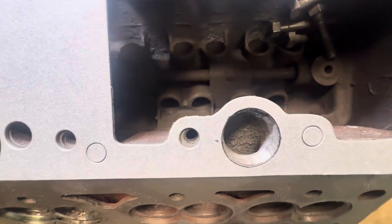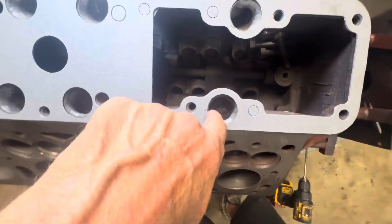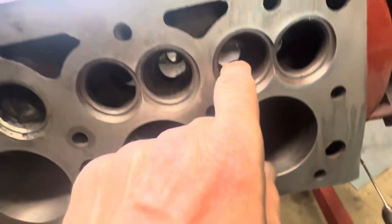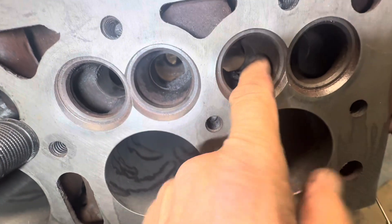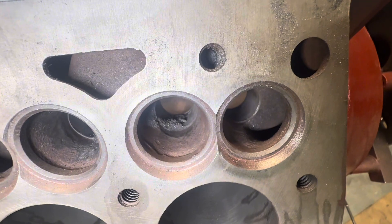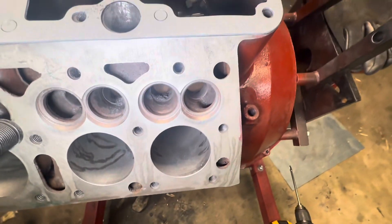Starting to look pretty good. Not going for gold - since there's no flow meter or anything here, I just want to open this up and make sure things are going straight with no bell-shaped thing going into the port. Raise and blend the roof a little bit. Then I'm going to get in here with the ball and open the area around the valves, the sides of the bowls - open up the bowl slightly, just take that hard line out of there. These are really small. Maybe this is just a miniature version of the flathead - they might even use the same valves. Open that up, round these out a little bit, then I'll start doing the exhaust ports on this side.